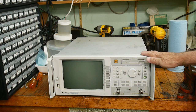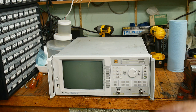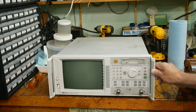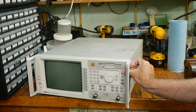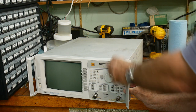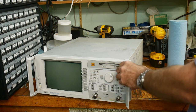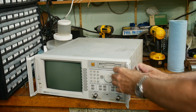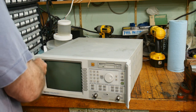Time to open this thing up. Let me show you how to do that in case you get one of these things. The hardest part of everything is getting off the front panel. On the sides of these rack ears is a little piece of plastic, and it took me a long time to actually pry this thing loose. It's just a little piece of plastic stuck on there, but you're worried about breaking it. You really have to get something thin in there and just lever it out, and then these will come out. There's one on each side.